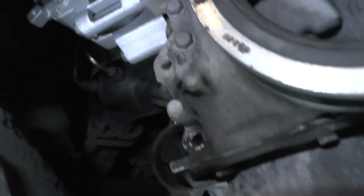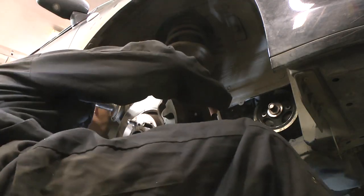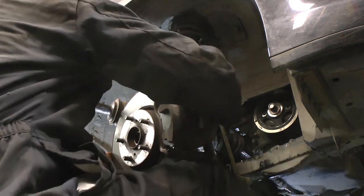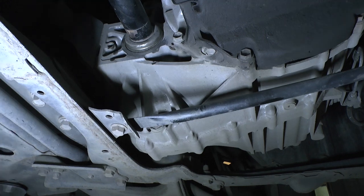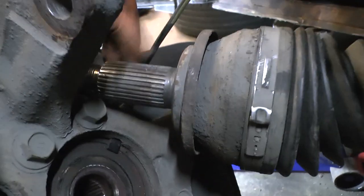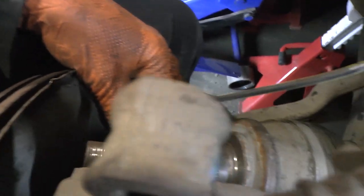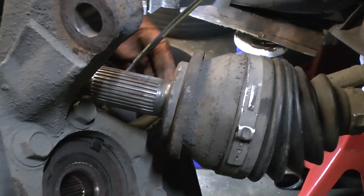There's a little hole in the top of the carrier — the thing that allows the drive shaft to fix — so make sure that's lined up. It's quite hard to see. That's fully in there. There's the drive shaft bent into a slightly wrong angle, and there's the ABS sensor that should have been released — I'm not going to do it now. The drive shaft has to go back into that hole and it'll take a bit of bending to get it back in.